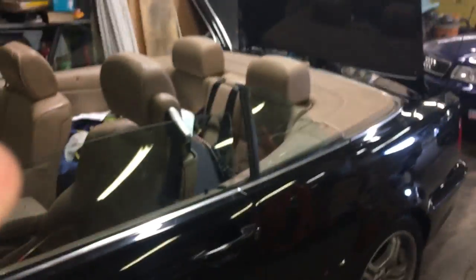Coming over to the left-hand side, you can see this puddle — that is the hydraulic fluid. There are cylinders all along the side here which you'd have to disassemble. Looking at the bottom, see that little drip? You'll notice it's wet underneath near the wheel well — that is where I am leaking the convertible top fluid from.